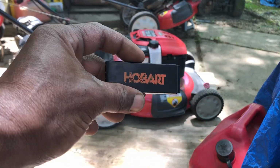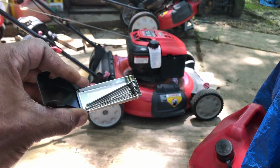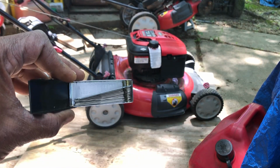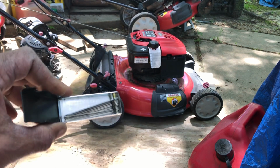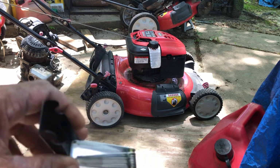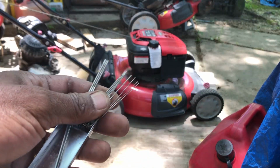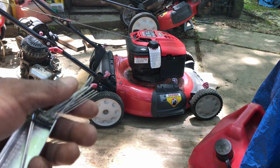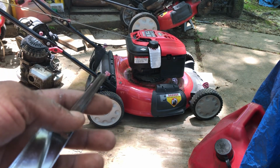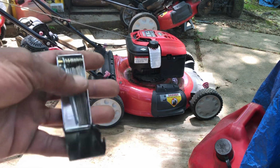This is for welding, but you see them online sometimes, eBay, stuff like that. They sell these also for cleaning carburetors, passageways, and stuff out. I thought of that a long time ago, and that's why I picked these up for welding, because you got small needles in there, all different sizes to help you clean out jets and stuff like that. And that's what we use to clean out that rubber passageway for the fuel inlet with the seat and everything, so we don't damage anything.